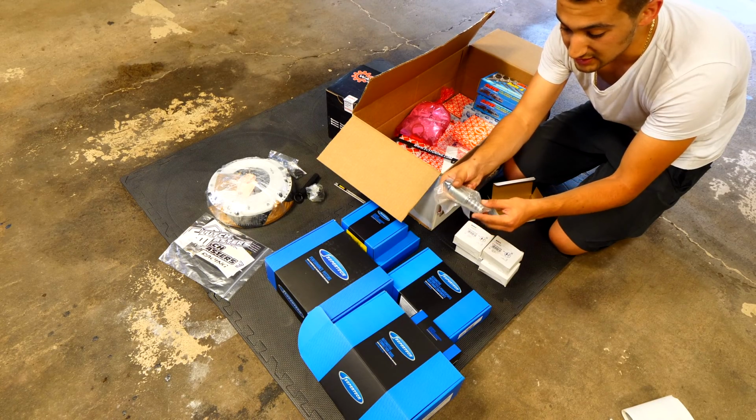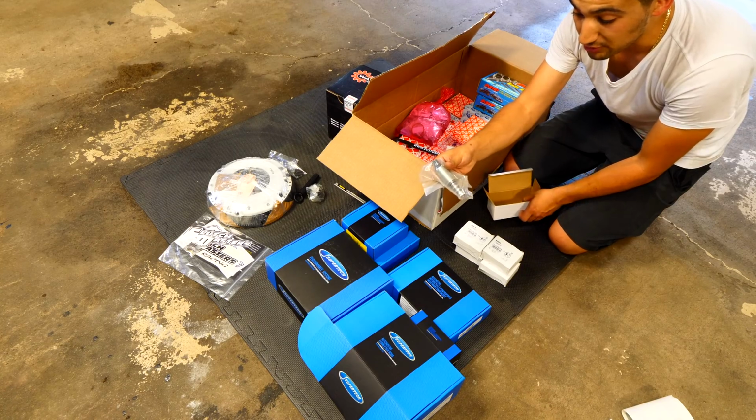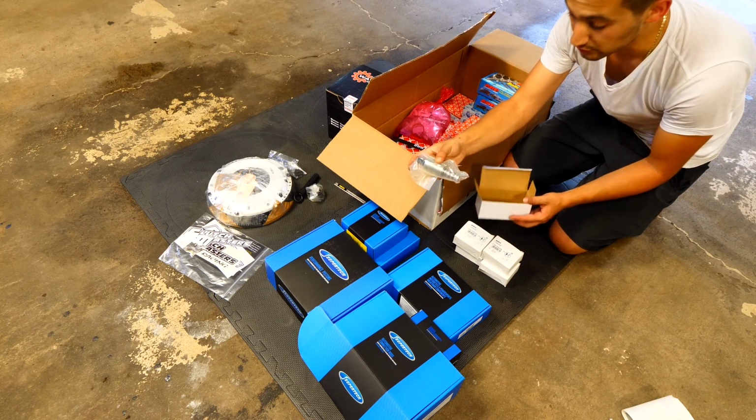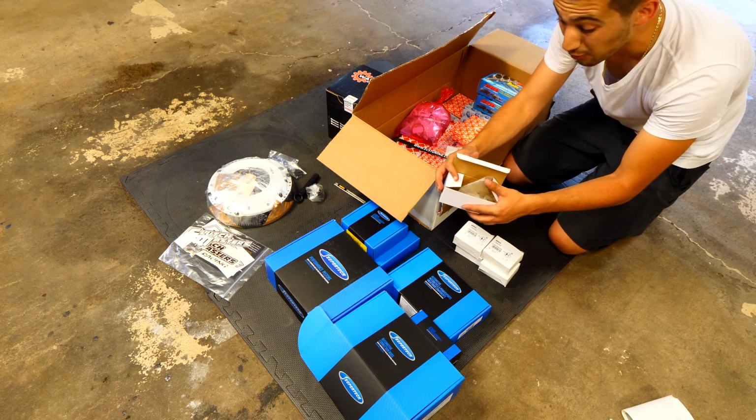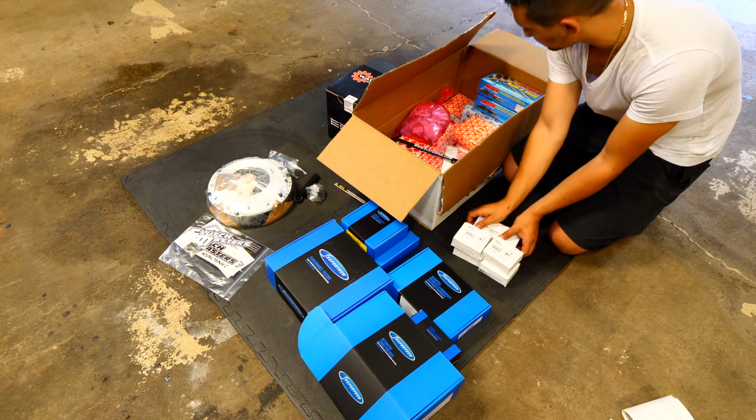When this oil screen gets filled up and gets disgusting over time through all the oil changes, it's very important to clean that out or replace it while you're doing this process. Because I've got the engine apart, I don't want to chance it by just cleaning it, so that's why I have a new piece right there.